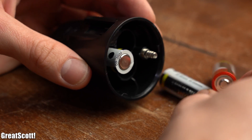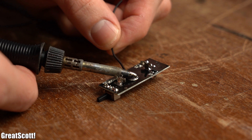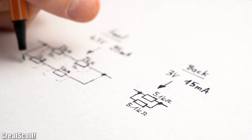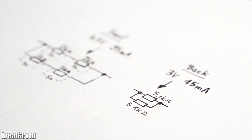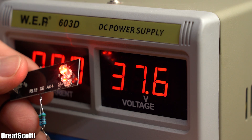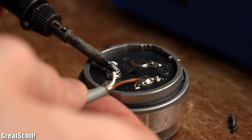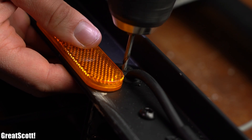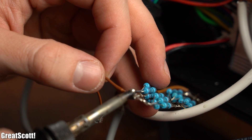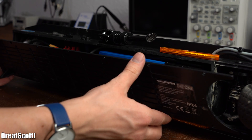For the last upgrade I wanted to get rid of the external batteries used by the front and back lights. So I soldered wires to the battery terminals in order to determine how much voltage and current each one requires. With those values in mind I calculated a suitable resistor network for each lamp and created them to hook up and test whether the lights would function correctly with the high battery voltage, which they did. So I drilled holes in both lamps through which I fed a wire, which I soldered to the electronics, then drilled additional holes into the frame of the scooter to guide the wires into the electronics compartment. There I soldered the wires to the resistors and the battery power according to the wiring diagram, and after securing the lamps with a bit of Loctite my scooter upgrade was pretty much complete.